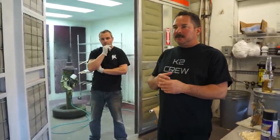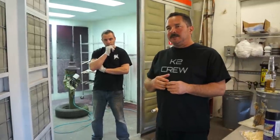This one we're going to show you guys what it should look like when you're in the paint booth and you're laying it down, because there's some confusion. I think most of it is some guys have improper gun setup and are maybe laying it down too thick. Jason's here with the gun set up and we're going to lay it down on a couple of speed shapes real quick. Once they're dry, we're going to go in the tank and demonstrate the application and proper technique, laying down the activator and stuff like that.